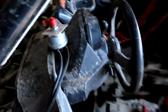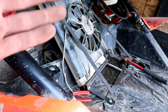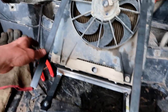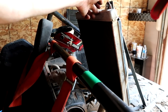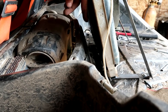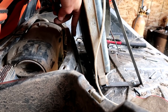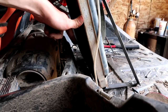It's been a bit and we've got quite a bit accomplished. Jason's been taking care of the electrical and I've been taking care of the welding. I've got three pieces welded here and two other pieces cut and notched, so it'll sit at an angle that allows the air to hit the radiator, disperse across the surface, and keep this thing cool.